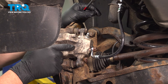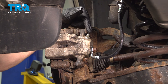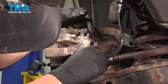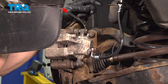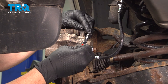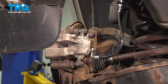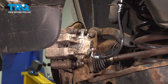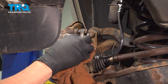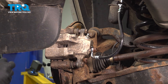Once we have a solid steady stream of brake fluid coming out with no air bubbles showing, we're going to tighten this down. Just gently snug that into place. Use some solvent to clean any residual brake fluid. Once that's done, pop the rubber cap back on.